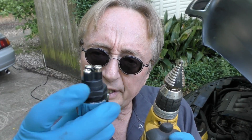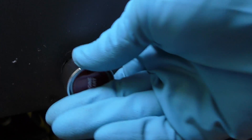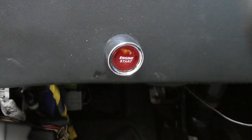The first thing we have to do is find a place to mount it with enough clearance. We'll pull out this cover and see — hey, there's a lot of clearance here, nothing blocking the back. So we're going to drill a hole right about here to mount the switch. It's a pretty big piece, so I've got one of these cool stepper drills with all the different layers. We'll drill until the switch fits in the hole — and there it is, fits in there perfectly. Now there's a cool starter switch. It doesn't do anything yet because it's not hooked up, but it looks pretty good.